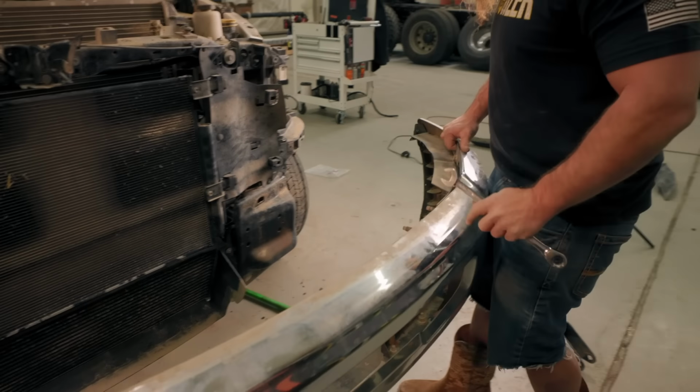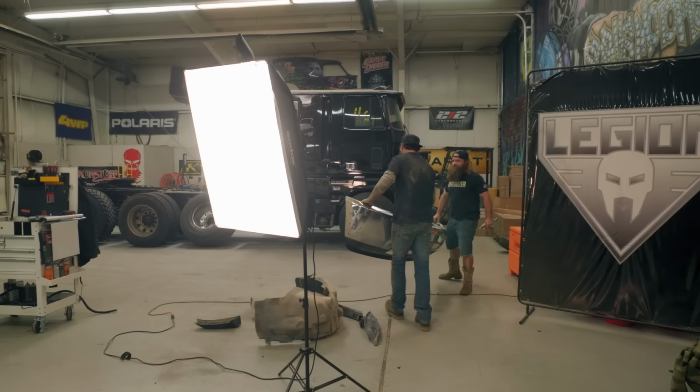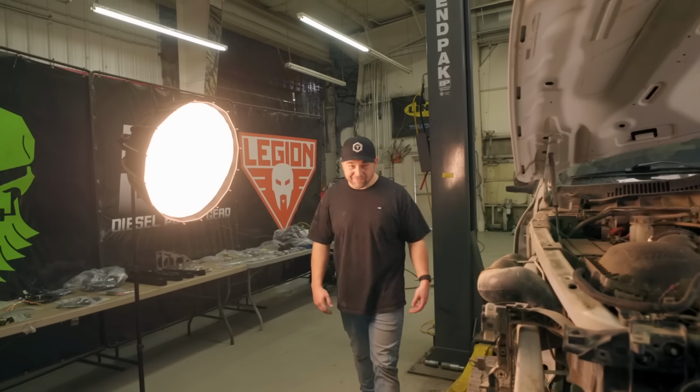Hooray! We did it! It only took us 3 hours. Carl got a nap in. We're gonna unload the suspension, basically probably use the lift, jack it up a little bit, take all the tension off the springs, shock absorbers out, springs out, control arms, drive shaft, and then we'll start modifying parts. So with that, serious day today. Yeah. Serious day. Get serious.